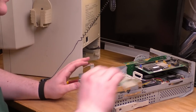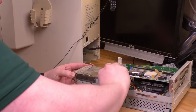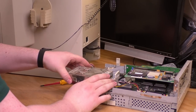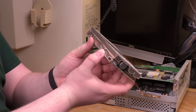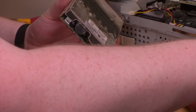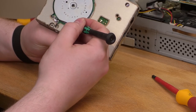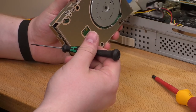Oh, wow. That drive is really wedged in there. It's coming, but I gotta wiggle it out. Just to pop the cable here, if I can do it without damaging anything. Oof. Wow. The floppy drive is rusty. Nothing else in here is really rusty. Now, most likely, there's just a linkage that's stuck in here due to being under-lubricated. You know, the grease on it went bad. And if I can just get that loosened up, it'll probably solve the problem.